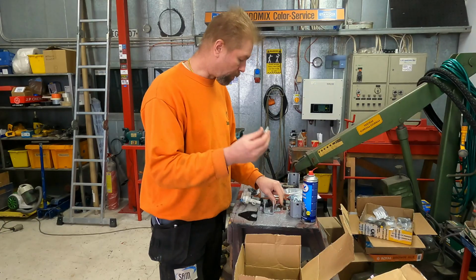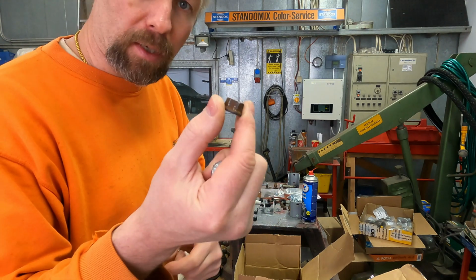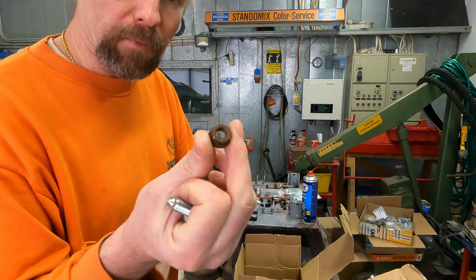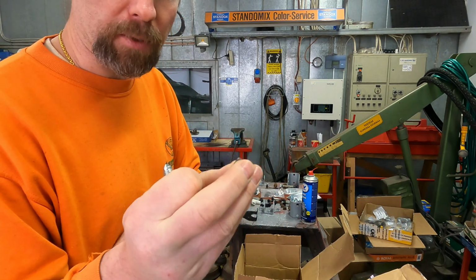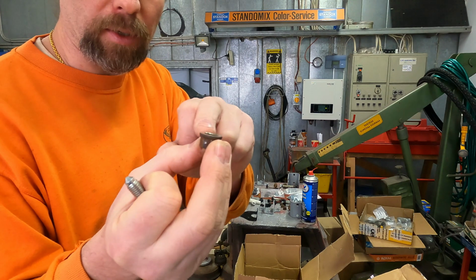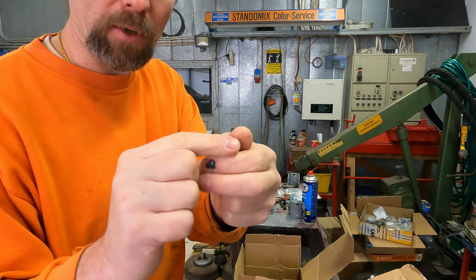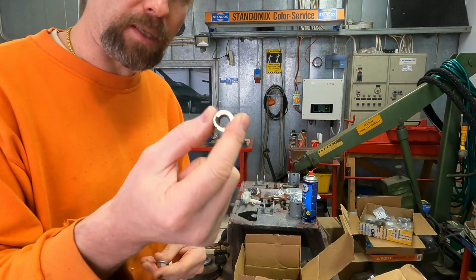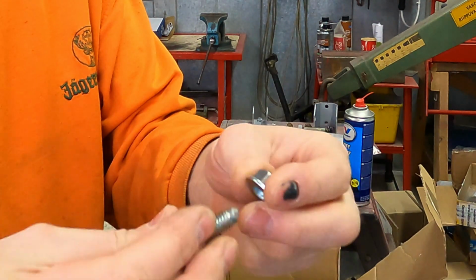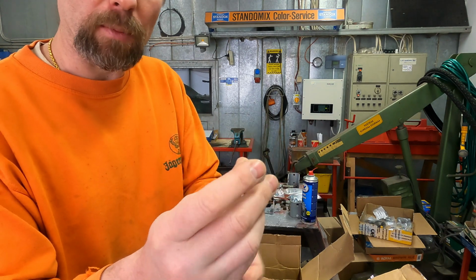I found some nuts for these bolts which mount the rear diff carrier. The original nuts are like this. They are 10th grade, but I'm not sure whether they should be self-locking or not, but the Volkswagen parts book says they are just collar nuts. I think the collar means this flange which is here, so that does not signify self-locking nuts. If there is a self-locking nut, they say it's self-locking nuts. I found a quite similar one with a bigger flange, but never mind. These are 10th grade, and these bolts I found from a Volkswagen OEM shop from Slovakia.